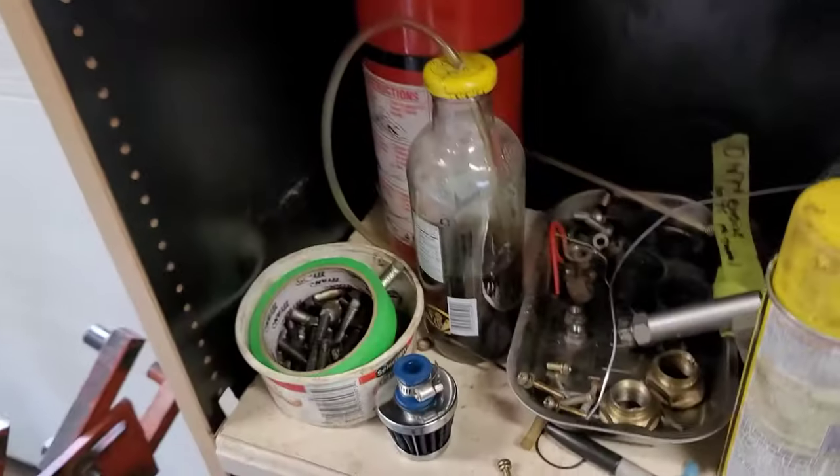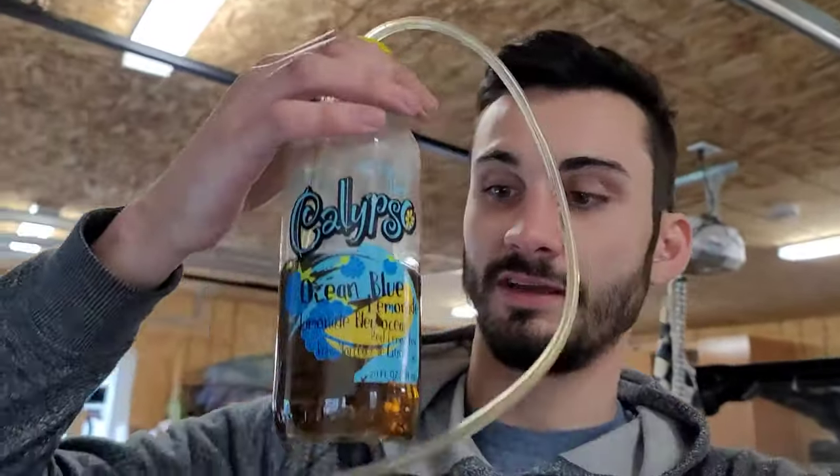We have here this bottle with some fluid in it. I've been saying this for years — I see people talking about how you can't bleed brakes on your own, you need two people, or you need to buy a $100 tool. No, you don't. You literally just need to grab yourself a bottle, fill it with some fluid, put a hose on the top. You just pump it until it's a steady stream of fluid, and all it's going to do is suck more fluid back in when you let go, so there won't be any air bubbles. Pump it until there's no more air coming through and you've got a steady stream, then you're done. Just loosen up that nut, push on the clutch pedal until there's no more air coming out while you fill fluid in the reservoir, and it'll be done.